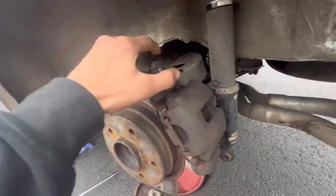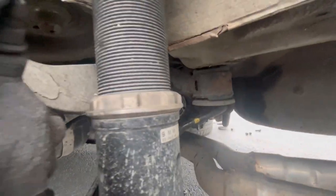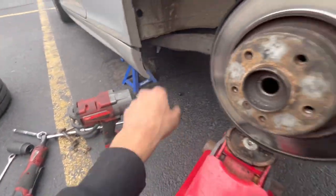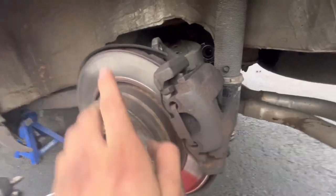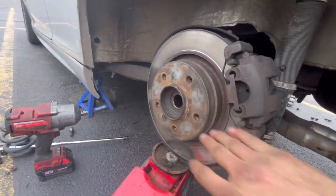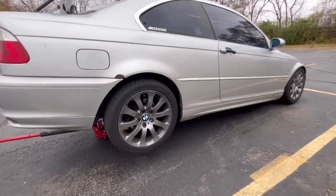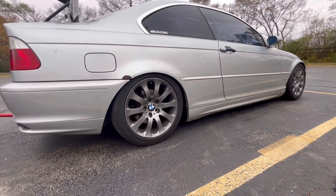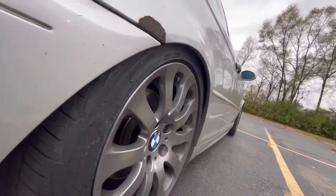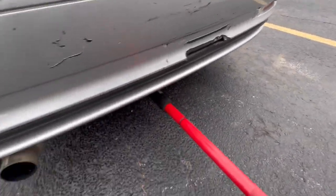Just quickly undo all this, don't think about it - just zap, zap, zap, done. This top one does take the longest to be honest because it's a little tedious. Then I got this E12 extension, zap off all the bolts from here. It's kind of hard to see because I have this jacked up, but before it was drooping down - you can zap off all the bolts and then bam, now you're at this. Pushed it out. Next one's gonna go right in straight through here - you just grab the axle, slide it through, bolt it up through here. That way it pulls as far forward as possible, slide it up in there and then everything else is self-explanatory.